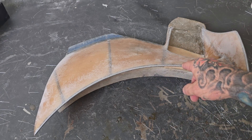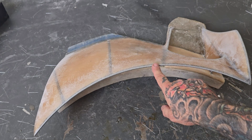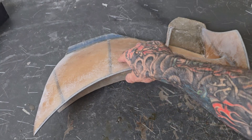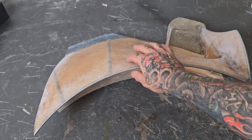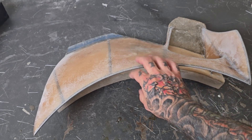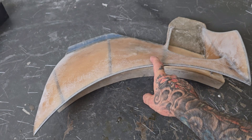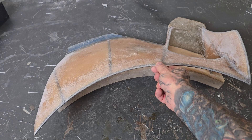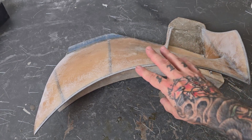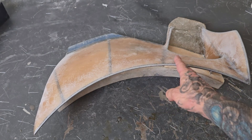Now I've had people say, yeah, that's all well and good, but that's just still going to fall apart in time. So let me elaborate: for this round rod to actually break free of the fiberglass after it's fully encased, it is going to have to break every single one of these welds. On top of that, the foam that I used as a backer for the fiberglass has been bonded with a contact cement — when that stuff dries, it is rock hard. So this metal, in order for it to work itself free from the fiberglass, these welds would have to break, all the joints with the contact cement would have to break, and at that point this metal would then have to start vibrating and working itself through at least an eighth inch or more of fiberglass to actually become a problem. The only way something like this is going to become a problem is if the thing was actually hit — collision, whatever — and at that point, this part's ruined anyway.